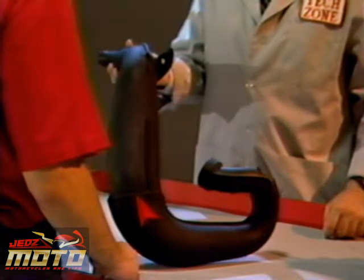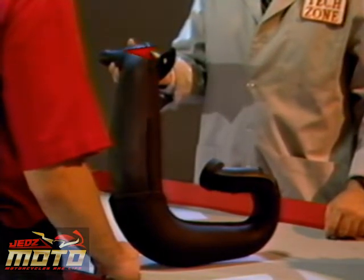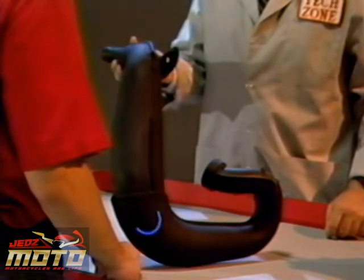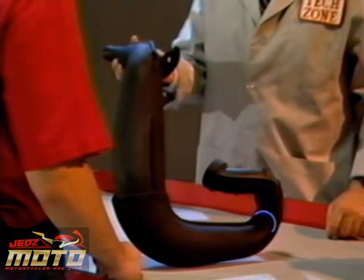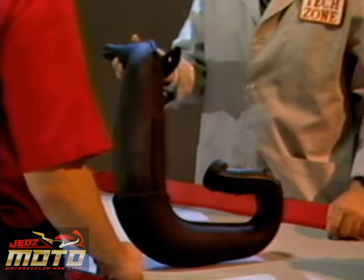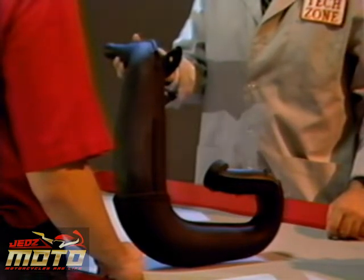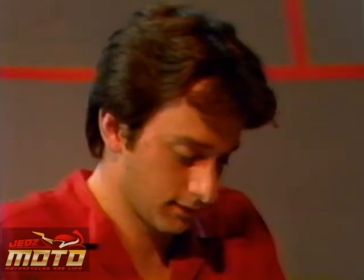As the exhaust pulse reaches the baffle cone and outlet pipe, it sends back a reflected sonic wave, which keeps the fresh fuel air mixture from escaping through the still open exhaust port, and the outlet pipe creates just enough back pressure to enhance the reflected sonic wave. This expansion chamber design is most efficient within a fixed RPM range.